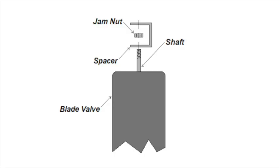Well, I found that the instructions were not very clear on how to adjust the mechanism, so I'm going to provide the details on how I did it here. To begin, temporarily connect the auto drain to the switch and apply power, then depress open and the rack gear will move out a little bit. You need about 1 inch or so of clearance. If you're not familiar with the terms I am giving here, consult the owner's manual for the auto drain.